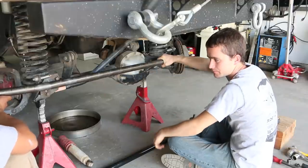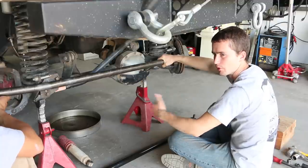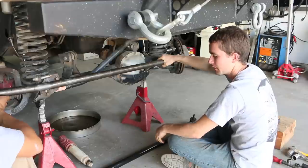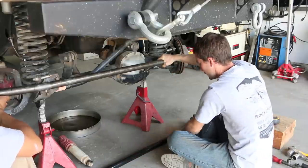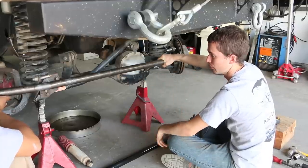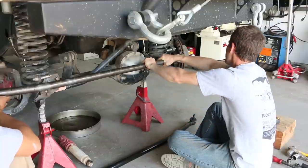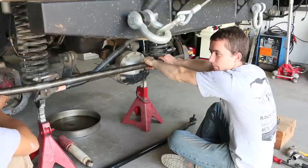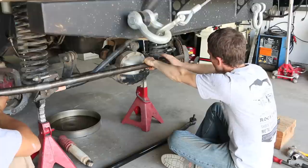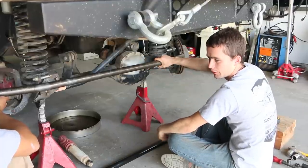We've bent our tie rod. In this particular case, we bent each side about 12 degrees plus spring back, so it's probably more like 10. We just knew we needed to bend it a little more than the previous one to get it to fit — based on your circumstances and axle selection, your mileage may vary. Right now we're holding this up and mocking it, making sure everything's going to clear. It does, so we're going to proceed to trim the ends, weld our bungs in, and then attach our rod ends.